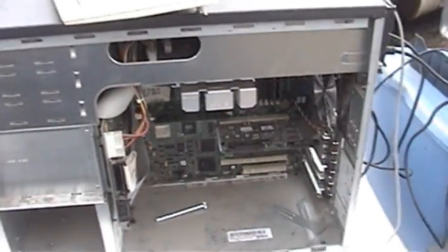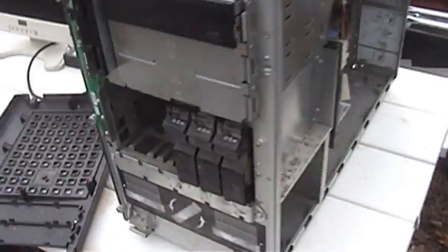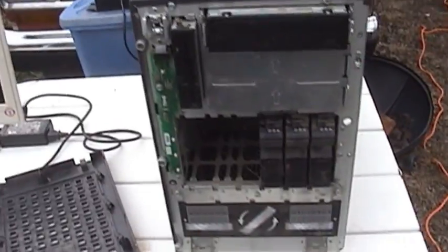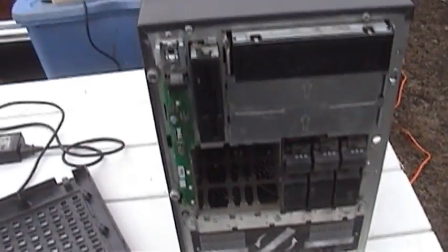I certainly hope so, at least, because on the Dell PowerEdge 2500 at least, the system's RAID configuration is maintained in volatile memory. I guess the enterprising system administrator was supposed to back that up onto a diskette and make sure to keep it up to date, which probably didn't happen with rather depressing regularity.